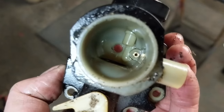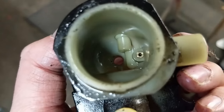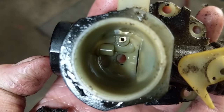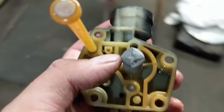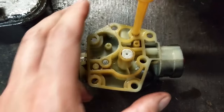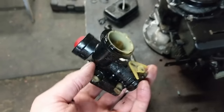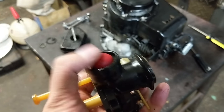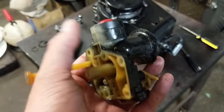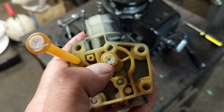There's one of our ports here, and then we have our primer bulb here — on this model it's supposed to shoot fuel directly into the carburetor through that little pickup and then right into your engine. The main thing that gets clogged up is that little brass jet and the main jet here. We're going to remove this screen and I can show you what the main jet looks like. A certain size lets a certain amount of fuel through, but they get clogged up and your engine won't run. So if you have a machine where you prime it three, four, or five times and pull the cord — it fires up and then dies immediately — what's happening is your primer bulb is working and shooting fuel into the engine, but your engine is trying to suck fuel through the main jet and it can't because the main jet's probably clogged, so then your machine just simply dies.